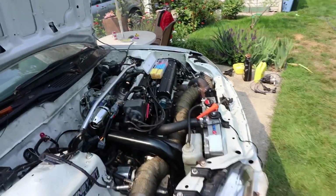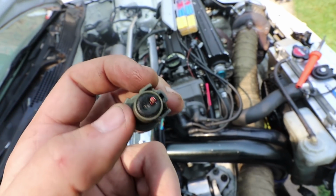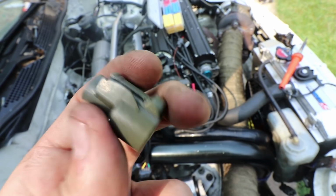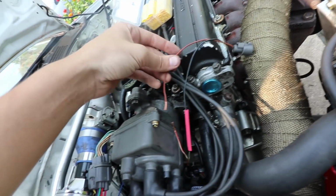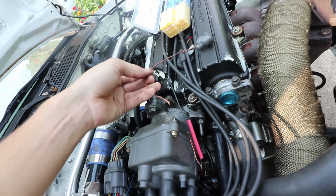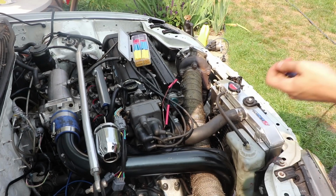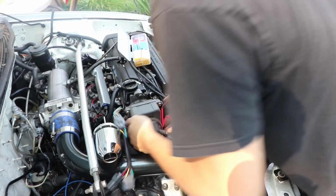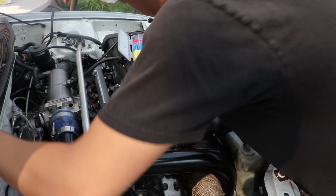So I've already started to do some wiring repair. But here's the old plug. I just cut the red side off, but the green side broke, and this connector was not doing anything. So I got a new plug, and I'm in the process of soldering it onto the old wires, and then we're going to see if we can get that code to go away. All right, now that ain't pretty, but it should work. Oh man, is it the wrong plug? No, that's the right plug.